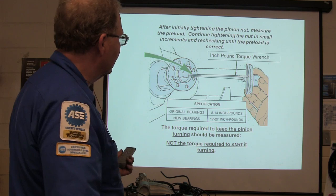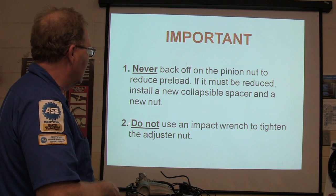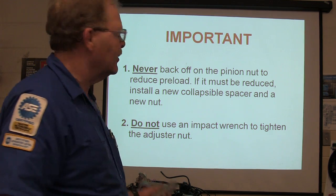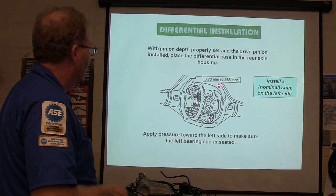That's rule of thumb stuff. Real close, gives you an idea of what you're supposed to see. Don't ever back off the pinion nut to reduce preload, because you'll have to put a new spacer in there. Don't use an impact wrench to tighten the adjuster nut. Never, never do that. And with pinion depth properly set and the drive pinion installed, and so on and so forth,